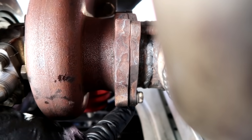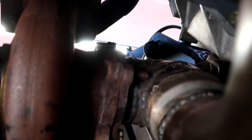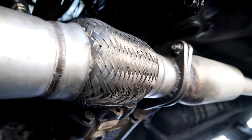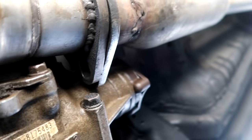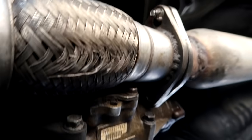Look at that. This is bolted. That one right here is bolted. This stud is through. I'm sure that one lines up, that fourth bolt at the top. And it's no gaps. And here's the downpipe. I got one bolt in there right now. It does not get in the way of the flange. Right? And the only thing touching is the flex pipe to one of the bolt heads right here. And I don't need to modify this.